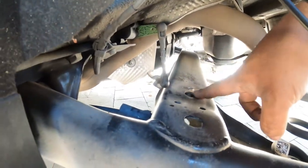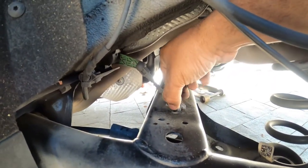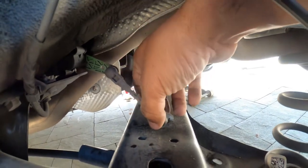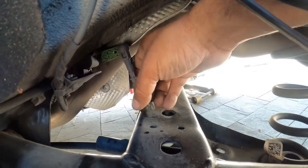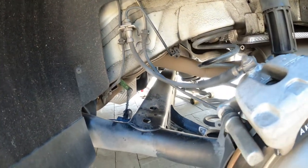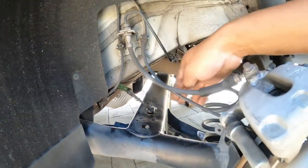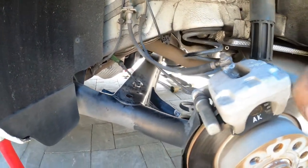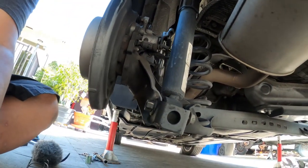This is held by a T27, and you'll see it just lines up in that little hole, just like this, and then the T27 holds it in place. That's what adjusts the headlight height on this car. So remember that — swing that out of the way before you do anything else, or cause any damage. I would put it up here since it can go all the way up and down without issue. Now we're just going to take off the shock.